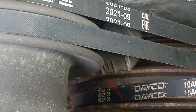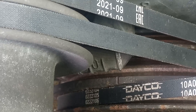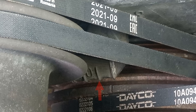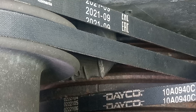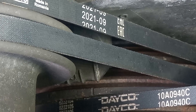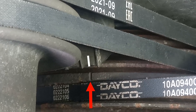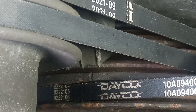This one is 20 degrees, and in between there we've got 15. These engines should be 12 degrees before top dead center - that's the timing we're looking to set today. From where it is, close to the 10, that region is basically where we want the ignition timing to be.